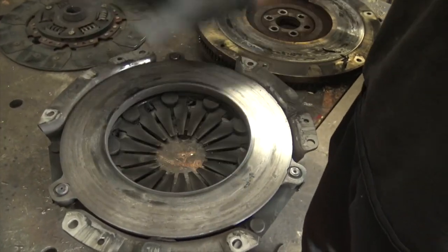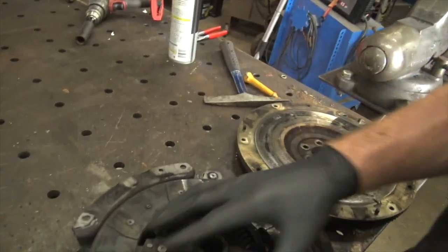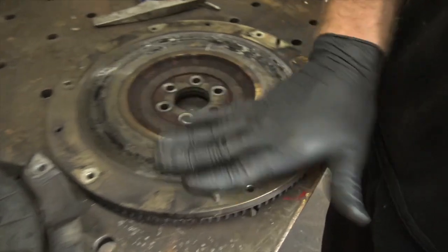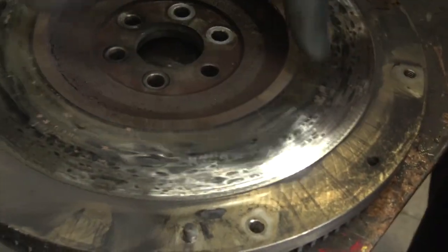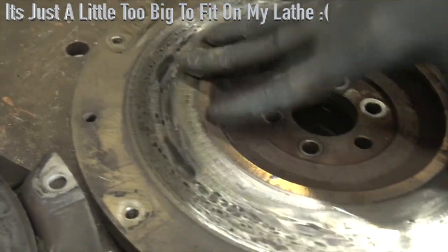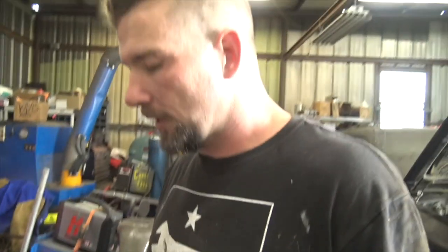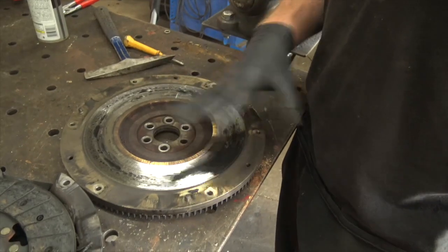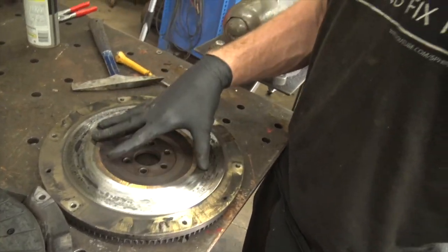Your clutch kit comes with a new pressure plate and a new clutch plate. On cars, I always suggest — and I'm not going to do a clutch job unless somebody will actually buy a brand new flywheel. You can take this to a machine shop and have it machined down, but the problem is I have to take everything apart, pull the transmission, drop the flywheel at a machine shop, wait a week to get it back. Flywheels are pretty cheap — this probably cost Chucky 30 to 40 bucks, even on the extreme side maybe a couple hundred. It's not $200 wasted — it's $200 of your time saved, because if you have to wait four or five hours or a week and come back to it, it's already paid for itself.